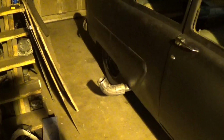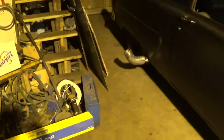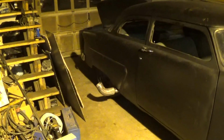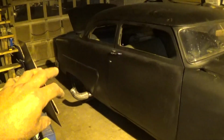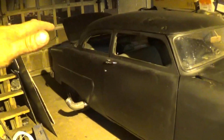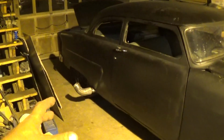I sent a few videos to the customer. He loves the tip. I didn't take any footage of it without the tip, although we did do a couple trial runs without it, and it's just not nearly as cool without it. When you put a bigger tip on, it kind of slows the exhaust gases down and they burn more yellow and kind of bigger and slower. Without the tip on it, it kind of just shoots out about 3 feet, a little more bluish in color.